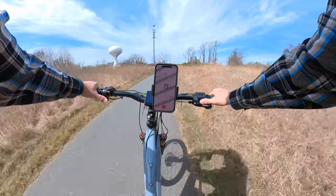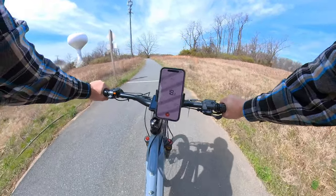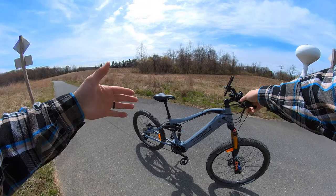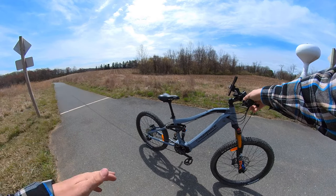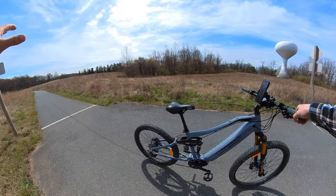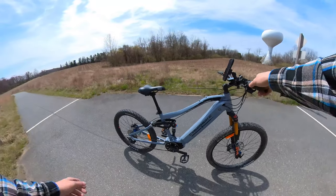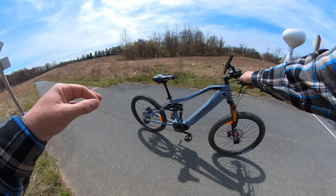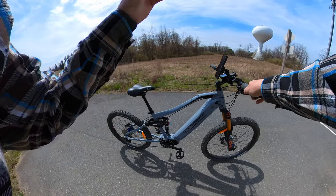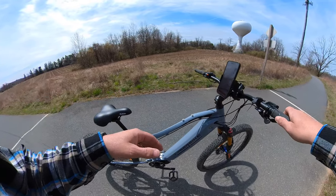Now we're going to test out these brakes — knobby tires on asphalt terrain — in three, two, one. I definitely don't recommend doing that; you don't want to ruin your tires like this, but for the sake of testing I had to get it done. Roughly about 22 feet from speed to full stop. The brakes work really, really well. On asphalt they definitely work well, and I expect them to perform on gravel too. When braking, lock the rear and feather the front — you don't want that front end washing out.